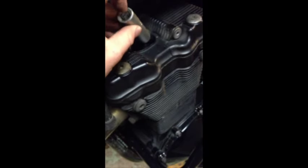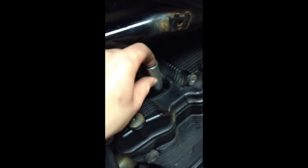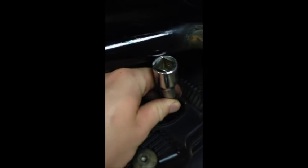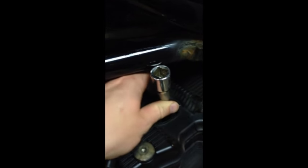What I do is put my finger in the end of it, place that down, and give it a little turn until it seats onto the spark plug. Then I get an extension and set that down to meet it — that's met it there.